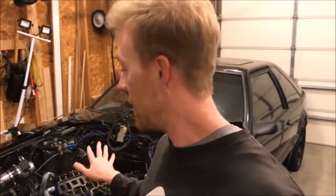Welcome back everyone to the GT40 head swap on the Fox Body Mustang. Today we're going to be talking about a couple very important things: top dead center and compression stroke. We need to know both those things in order to get a clean start when we finally fire this thing up. I'm going to talk about a few different methods — if you have your valve covers on or if you don't, also if your harmonic balancer has timing marks on it or if it doesn't.